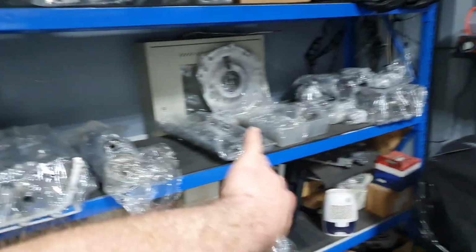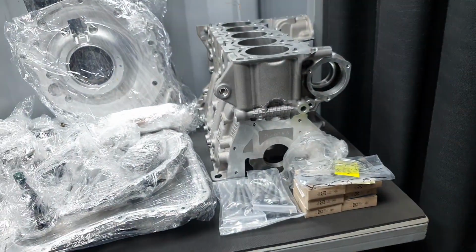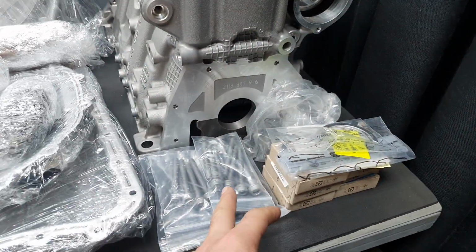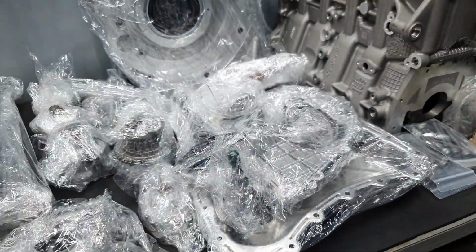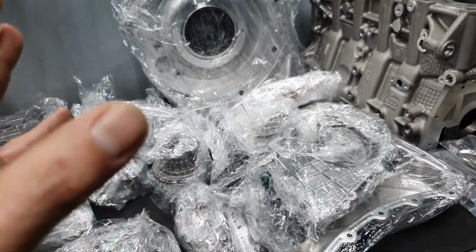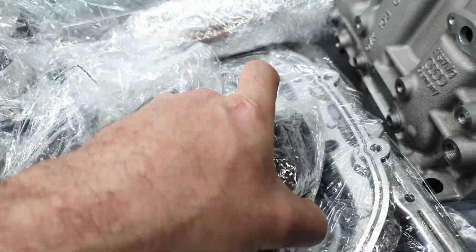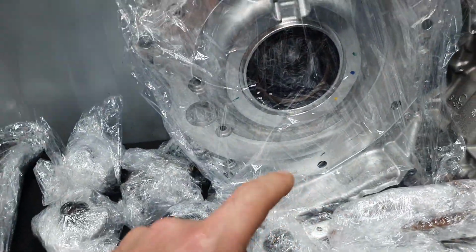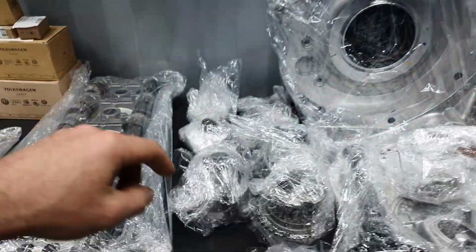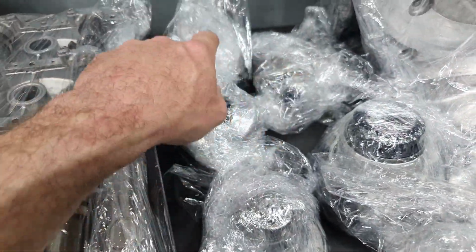This is a different engine. The cylinder head has been prepared for this engine, for the new block. I have here bearings, thrust washers, the crankshaft bearing cap bolts, timing chains, and I couldn't find up to now where I put the oil pump chain. Okay, I have changed this seal here, and I think I have the plastic inside here, and I have the o-ring there. I changed the crankshaft rear seal and put the o-ring in place. Same thing for the bottom one. The new gasket on the vacuum pump, the new o-ring on the water pump. I need the bolts for the cam adjusters. I don't have the bolts.